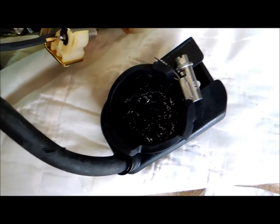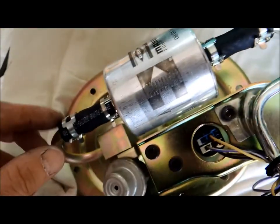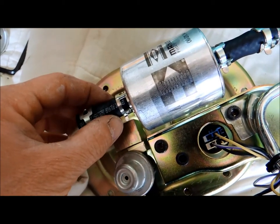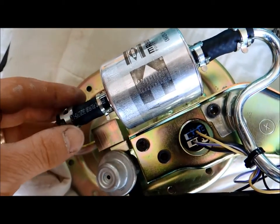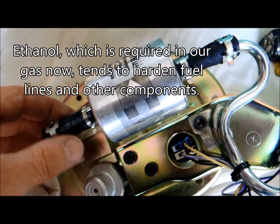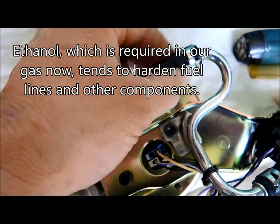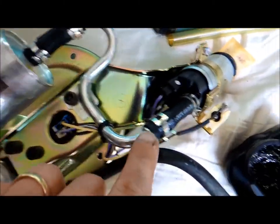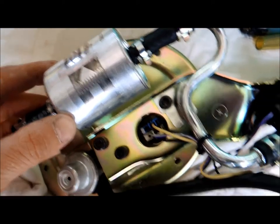I just want to give you a close up here — this part went very easy. These fuel lines were starting to harden up a little bit, and what I was worried about was we have so much ethanol in our fuel these days. It's an alcohol, and I'm afraid it's going to harden up these hoses — and it was starting to. So I'm glad I replaced those. The new filter fits exactly right — it's identical.